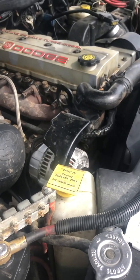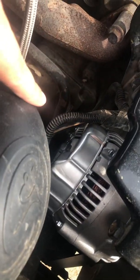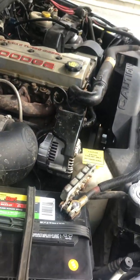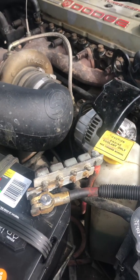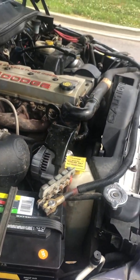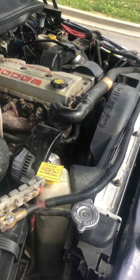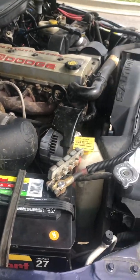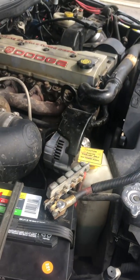Here's what it actually ended up being. There are two screws on the back of the alternator you can use to check how the diodes are working. The diodes are what control how the alternator generates its voltage. My diodes stopped working — they welded themselves wide open. So even though the PCM was only commanding a certain amount of voltage, the alternator was just pumping in as much as it could, as fast as it could.